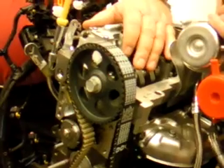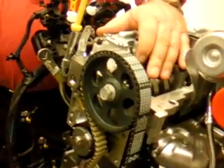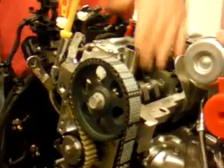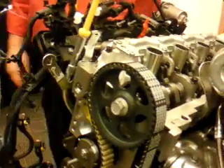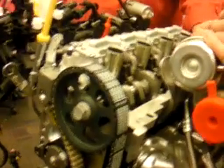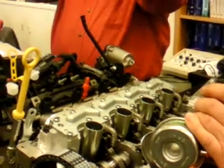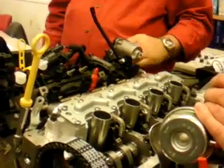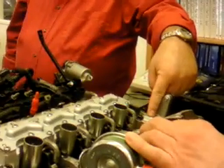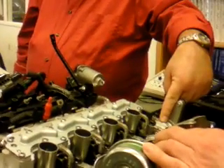Here is your chance to really screw up big time and break expensive stuff — break the camshaft right off. If you use this tool back here as a backup when you're tightening that bolt, the cheap thing is you'll break the tool. What is more likely going to happen is you'll split the end of the camshaft out — they don't like that. And now it's seized in the bearing journal right here. You've got to get a head — you need a head.